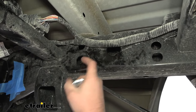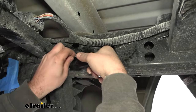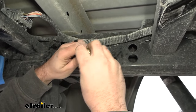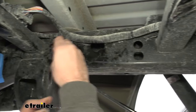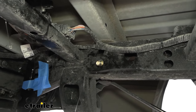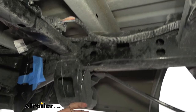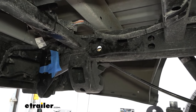The other mounting point is the hole towards the rear of the vehicle on the lower side, close to the access hole. Feed the fish wire over, drop in the spacer block, and feed on the carriage bolt. On this one, there's an extra spacer block that goes between the frame and the hitch. Push it back in and bend the fish wire to hold the spacer block in place so it slides into position as you raise the hitch. Repeat the same steps on the other side of the truck.